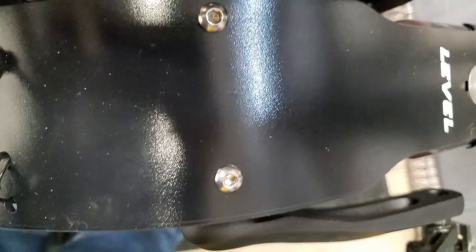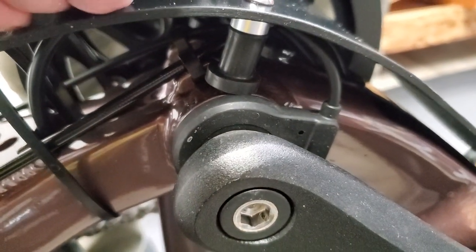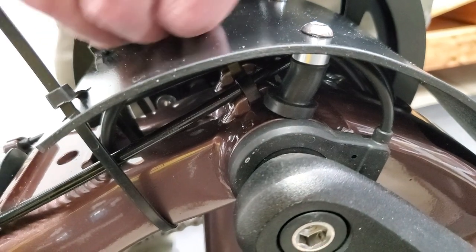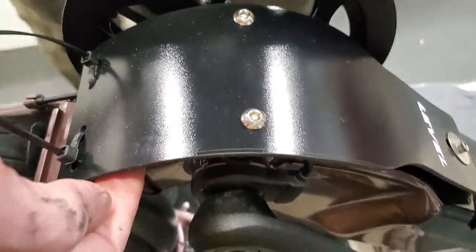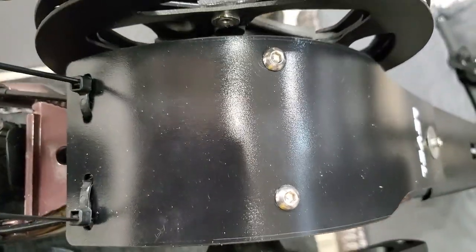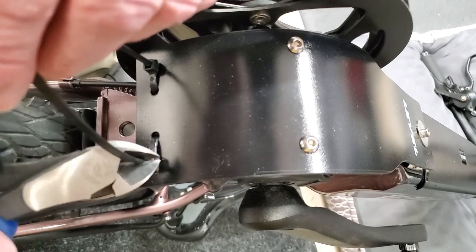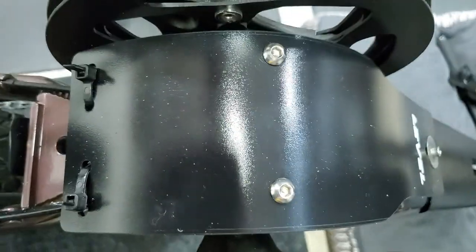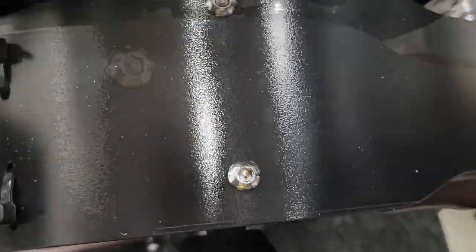Come back and ensure the bumpers are resting on the bottom of the frame, then cinch up and tighten them equally. Look in there once more to make sure you don't have any wires in a bind or restricted. It looks solid — then come back with your diagonal cutters and clip off the excess zip tie. There you have it: you've got protection for your crank sensor and all the wires underneath from getting snagged by rocks. Thanks for watching.